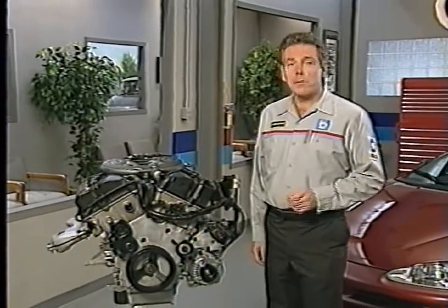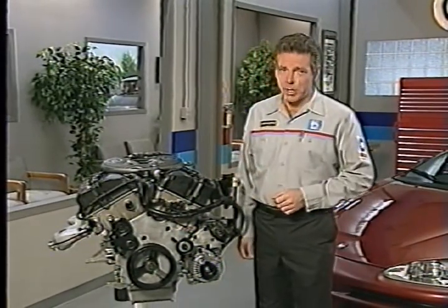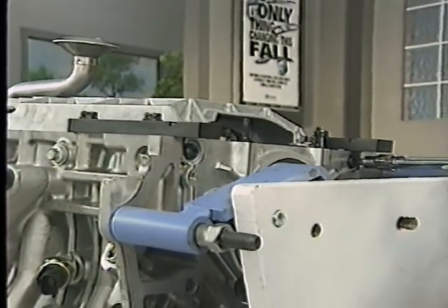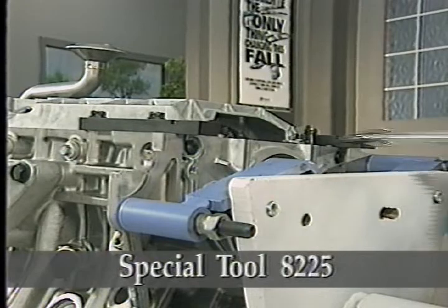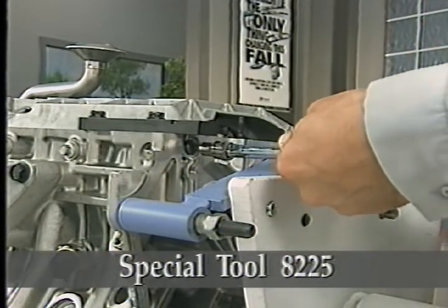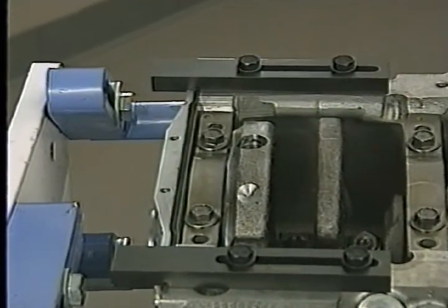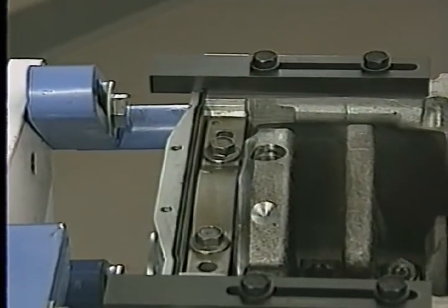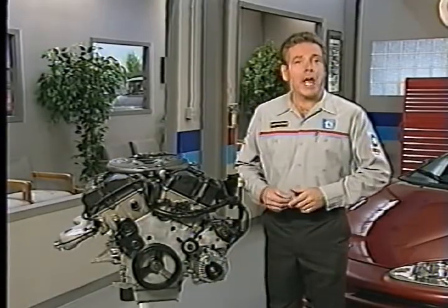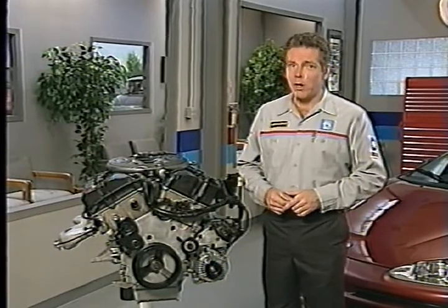At this point, let's take a look at some specific features on the lower and front end of the 2.7 liter engine. When installing the rear main oil seal retainer, use special tool 8225 to make sure the retainer is aligned properly. Later on, we'll see how you can use the opposite side of this same tool on 3.2 and 3.5 liter engines.